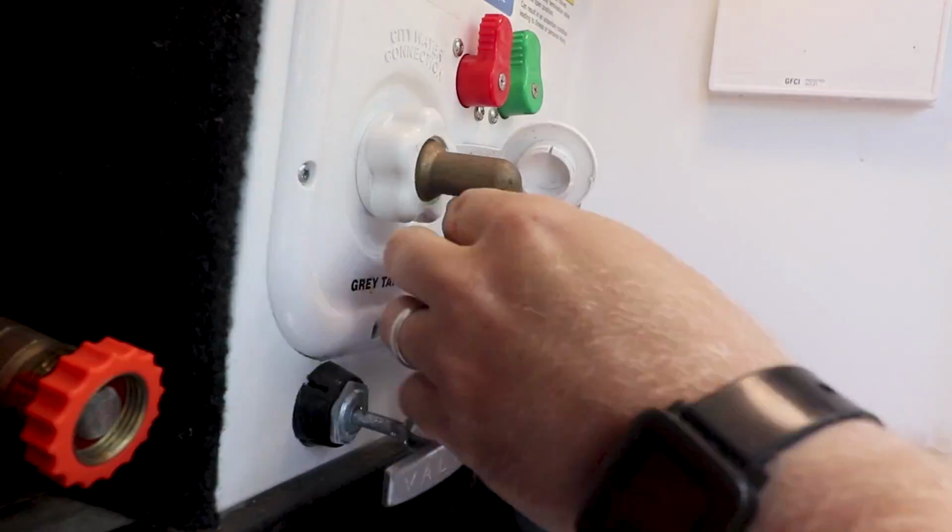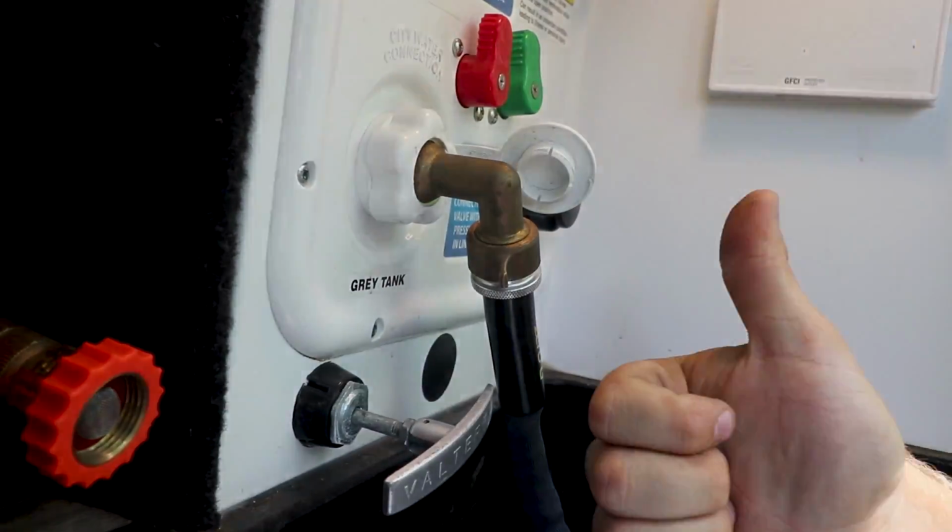Now the reason I prime the hose is because that's 25 feet of air that I don't want to shove up into the rig. It's probably not going to damage anything, but I don't want to risk it, so I prime it through there before I hook it up. So now there's only a couple inches where it's dangling. So then when I go inside, there's not a lot of sputtering and water jackhammering and all of that. So I'm just going to hook this up to my inlet and done. That's how we set up when we get to a new place.